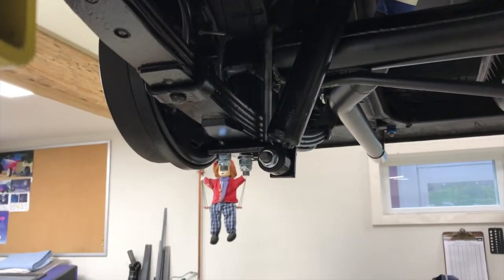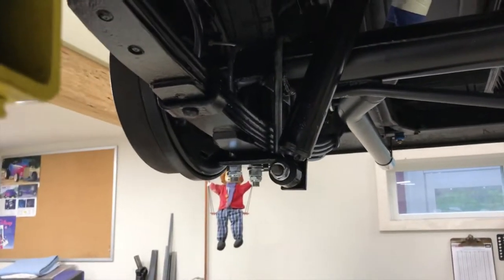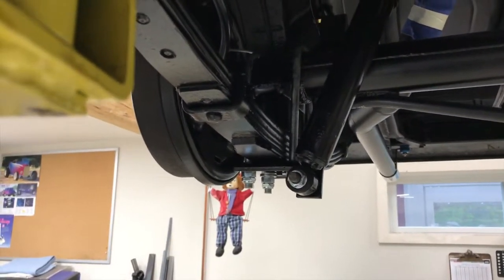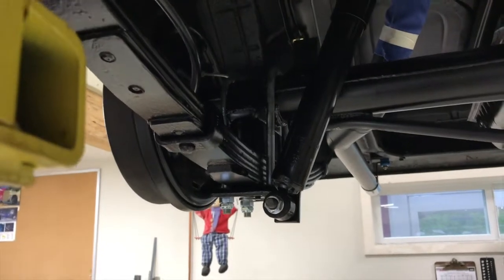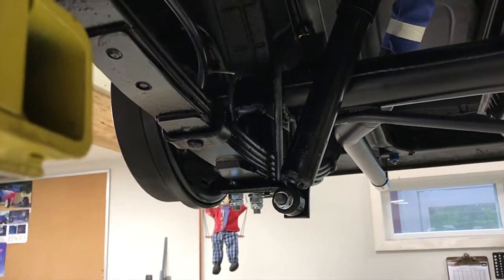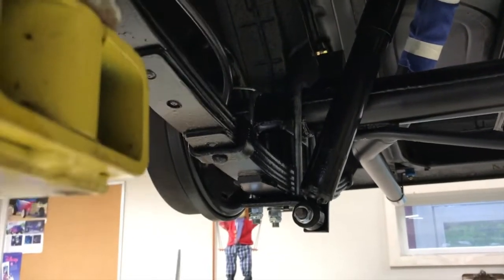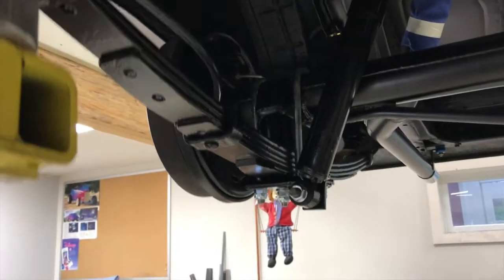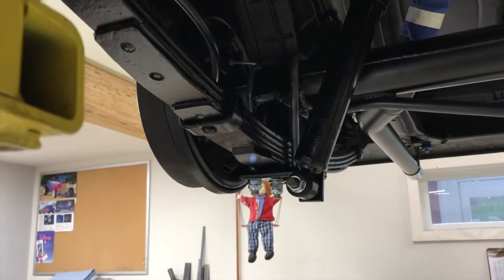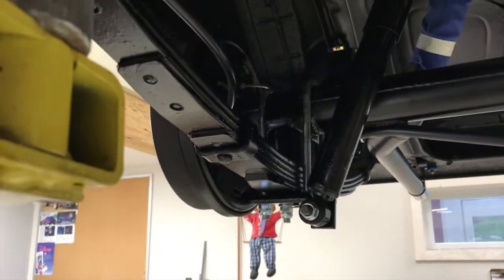The suspension to hang all the way down. The rear end's on lowering blocks, but that's not what I'm talking about. I'm talking about the suspension. The shocks, as they were originally installed, the way they were originally engineered, and these are supposed to be, and I think they are, the same size, the correct spec. They would not allow the suspension to hang all the way down. Consequently, we could hardly get the tires into the fenders without letting the air out of the tires.